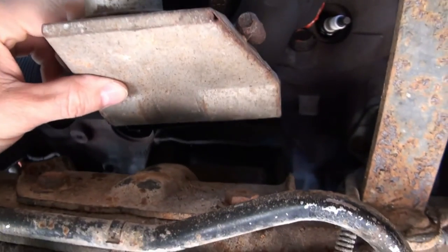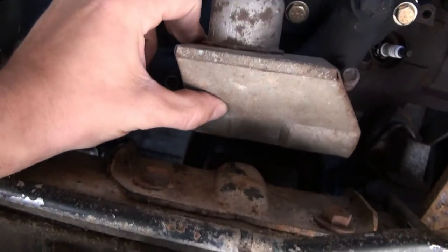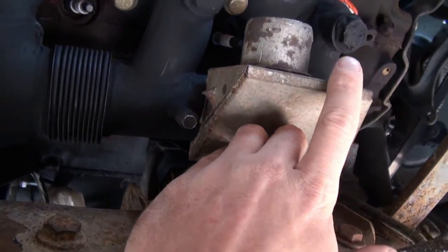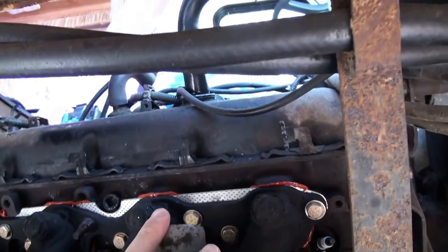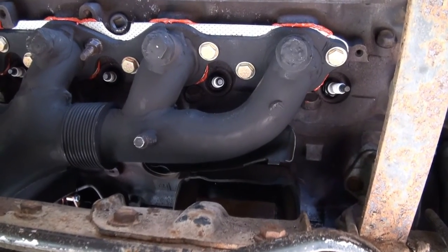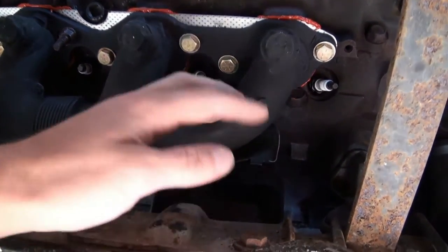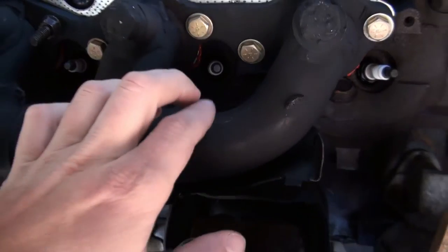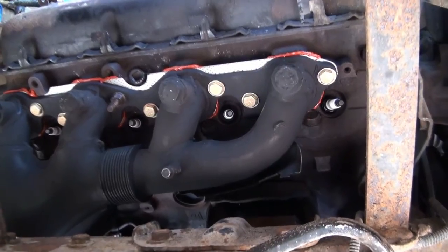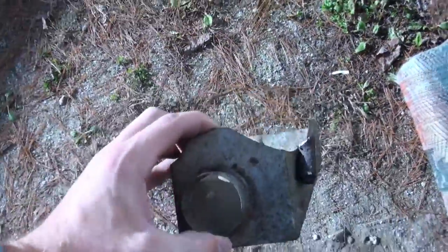It's kind of hard to get in now just because it's all twisted up, but it used to sit right there over the exhaust manifold. There is a pipe that goes up beside the engine and connects to the air cleaner. When air is being drawn through that heat stove, it is taking air that's circulating around that part of the exhaust manifold — and obviously that's the part of the engine that gets the hottest the quickest. So it is drawing hot air through into your intake.